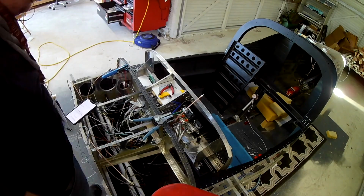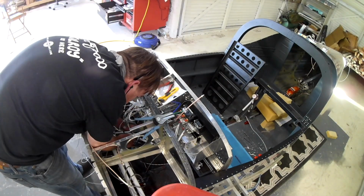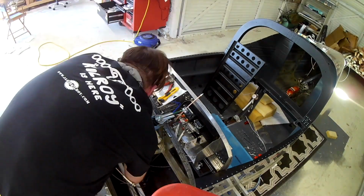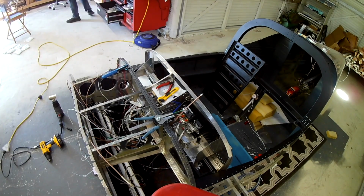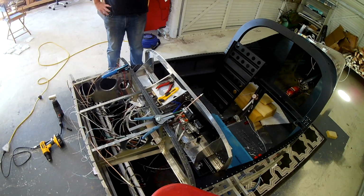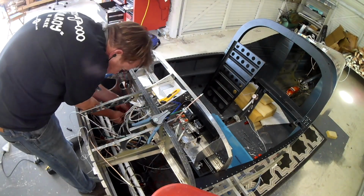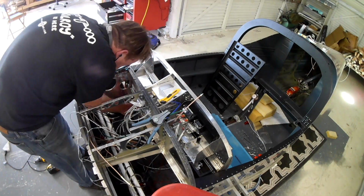And so the only problem is that I'd go to do a ground check, right, a radio check. Problem is the ground antennas are behind my hangar building, and I'm in the hangar, so no one can really hear me. I mean, I could hear myself on a handheld, and I could hear the tower because I can see the tower from the door of the hangar, but I can't see ground. So I'm not going to do a radio check on tower, I'm going to do it on the ground. So what I'm going to do, possibly today even, is hook up a 100-foot extension cord to the 12-volt power supply, roll this baby on out to where it can see all the antenna, and do a proper check.